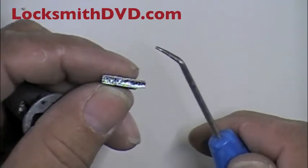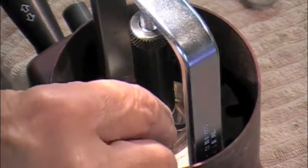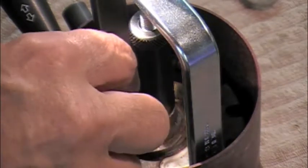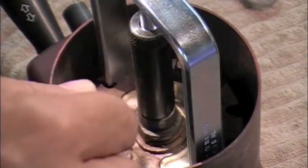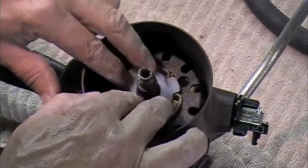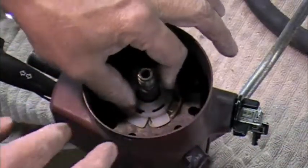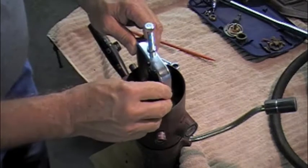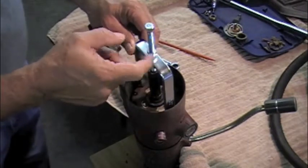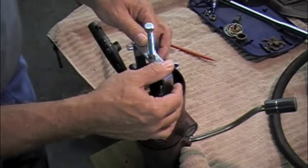As you can see it will come in and just fall inside the plug. If you have this plate depressed, this clip will just slide back. Put that on there — you'll hear it snap in. That's going to lock that steering column back. Then you can simply take a half inch wrench and screw this nut down and depress this.